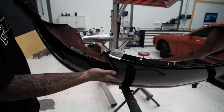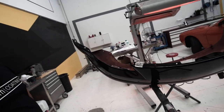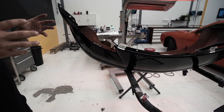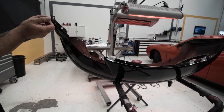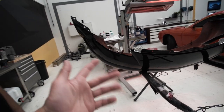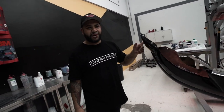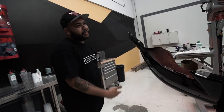You can just see it — it's cracked from there to there, and that would have happened from the same incident. That's the gel coat that cracked and it translated all the way through to the top. With fiberglass it's always going to happen because it's so rigid — when you take an impact it doesn't absorb or flex, it's just solid, so the only thing that gives is the weakest point. The front bumper especially, even a little pressure — like pulling into parking spaces with those judder bars when your car is low.